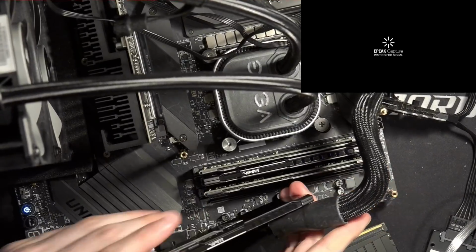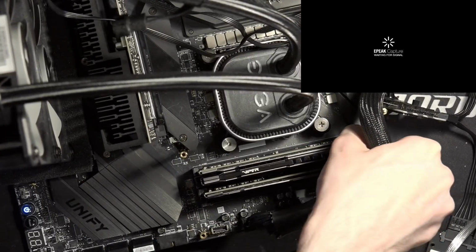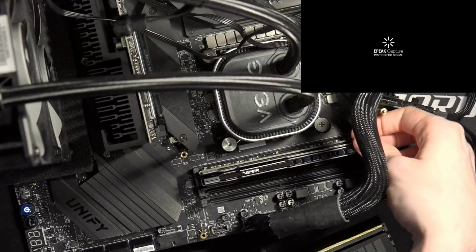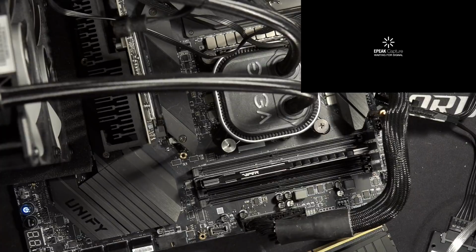And then, of course, we have the dual rank setup with the dual rank sticks, and then the 2 single rank setups with the single rank sticks, but in different capacities. And that's the other thing, again, with the 16 gig DIMMs, especially right now, if you're going to be buying cheap 16 gig DIMMs, going like, oh, I'm going to have great performance per clock, which actually is really useful, right? One of the easiest ways to get a bunch of extra memory performance without buying higher spec memory is to just get more ranks of memory, because if you run dual rank 3200 CL16, it actually performs pretty well. It's on par with, I think, around 3600 single rank.